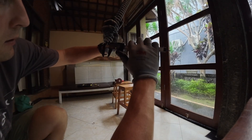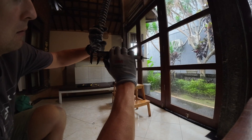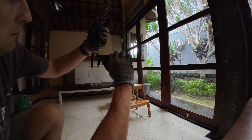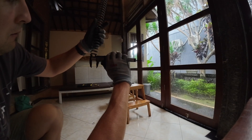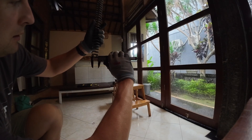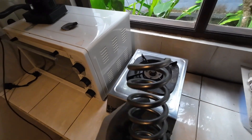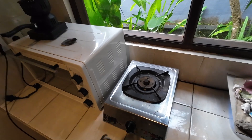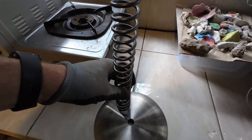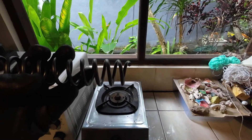The factory last coil diameter is 26.3 millimeters. After what we cut, we have 27.5 millimeters — I hope this will be enough. The next thing we need to do is heat the last coil, and then when it's hot enough, we'll be able to compress the spring so it bends to a flat surface. At least that's what I've seen on YouTube, so let's see what we can do.